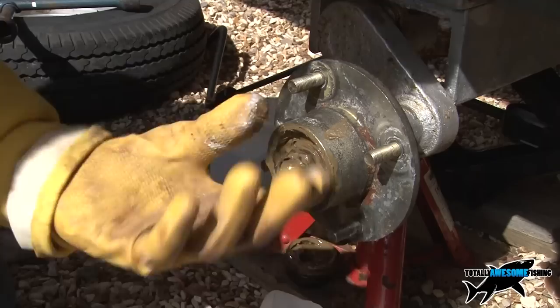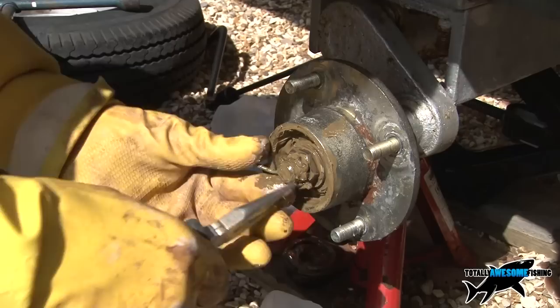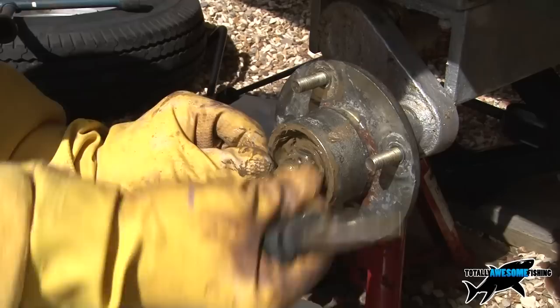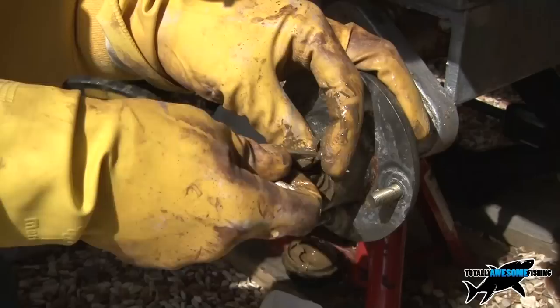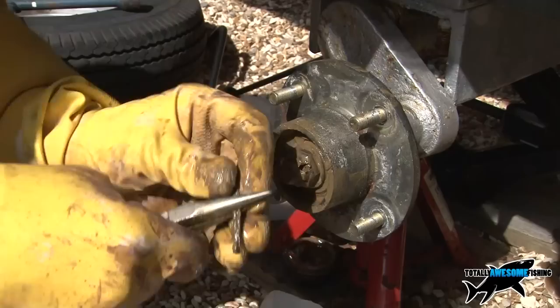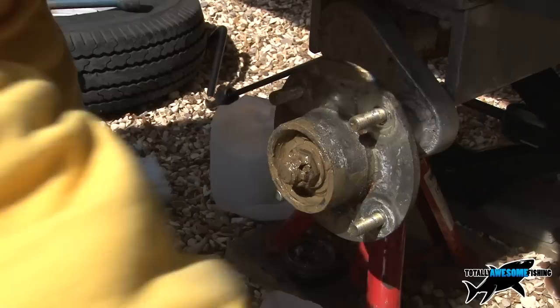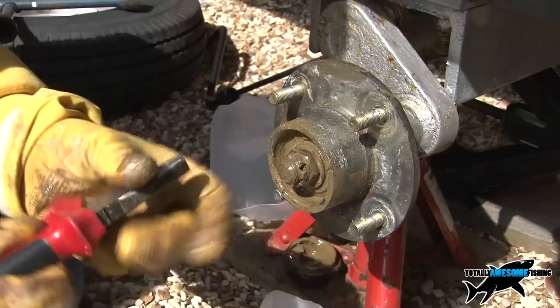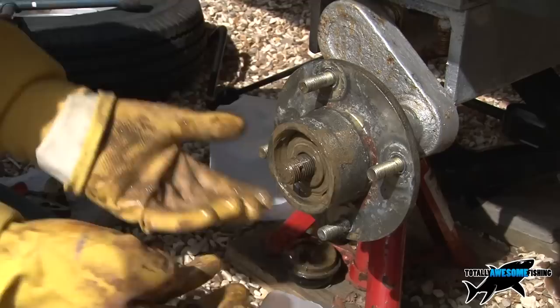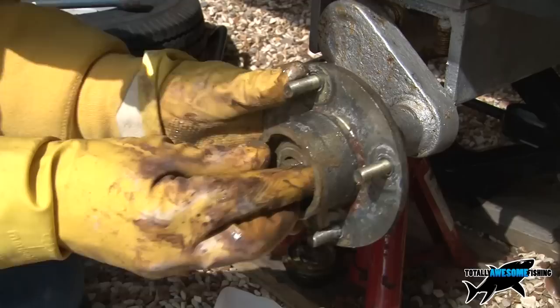Okay, I've located the split pin here. Open the split pin around, squeeze it together, and you should see it pop out. There's a little ring in the end — you can get the nose of the pliers there and pull it right out. You can save these if they're not showing signs of wear — you can straighten them — but they can be an absolute pain to get back in. Now at the end here is the castle nut. You always want it to spin, so this is only just over finger tight — I don't even need the pliers to undo it. So spin this off, take the castle nut off. Keep your hand underneath so you don't drop anything. If you've got these plastic containers, you can just drop them straight in — you know where everything is.